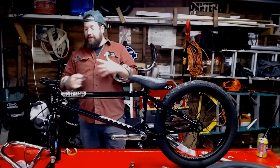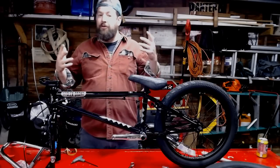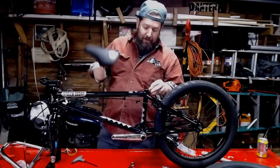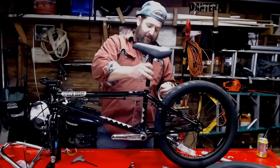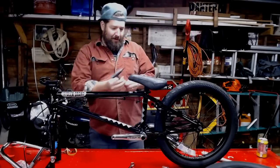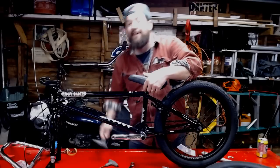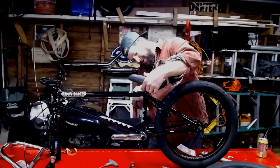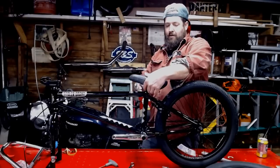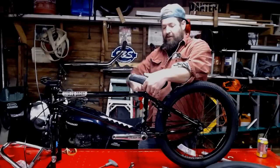So like I said, I'm going to assemble this thing like you're doing it on your garage floor. No bike stand. It's a good order to go in too, to keep from having to balance parts in some crazy format. So seat bolt is already in there. Step one: install the seat, and it is a six millimeter Allen wrench that is the seat bolt.